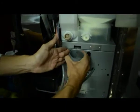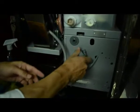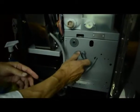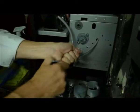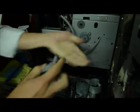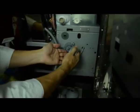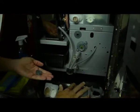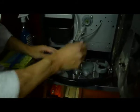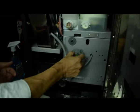Just one by one, pull them out. The middle mixing bowl section just turns slightly, then pull it out — it's not under any pressure, it's not screwed in, it just pulls straight off the hose. Then we've got our whipper blade, which I usually just lever off with one of the mixing bowl sections. And the last piece is the backing plate — just turns and then pulls straight off. Very simple.